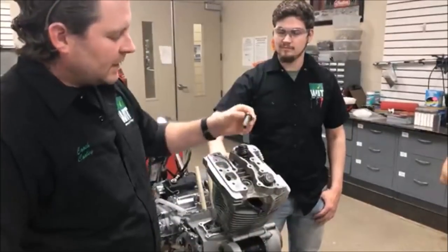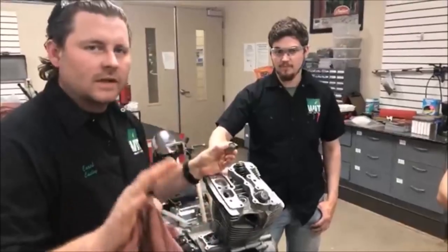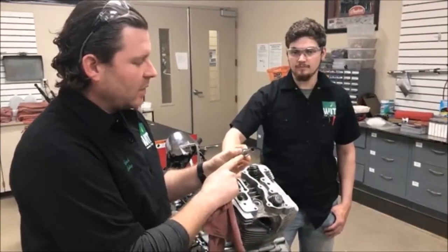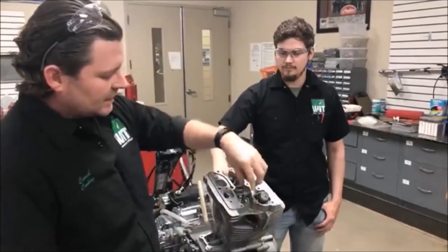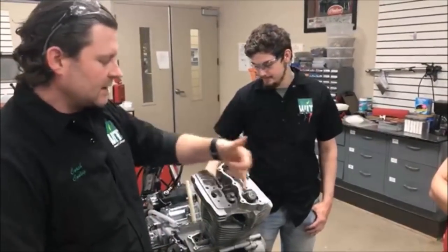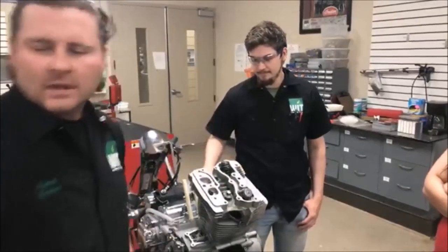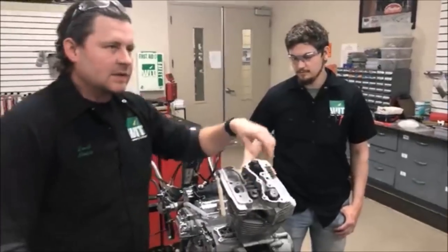But yeah. If you remember from our Snap-on training, Snap-on has some crazy great curriculum on fasteners and torque, right? And they said that when you're required by the manufacturer to put oil on here, what that's actually doing is making that act as a bearing surface. So when Harley Davidson said torque to this pattern and 120 inch pounds, then torque to, what was it on this one? 15 to 17 pounds.